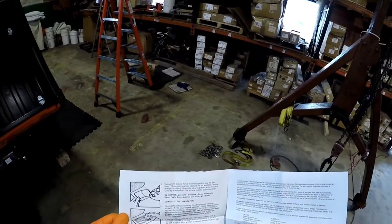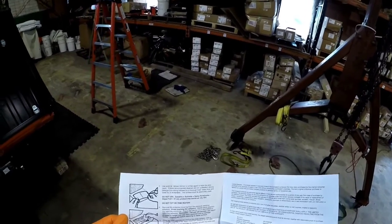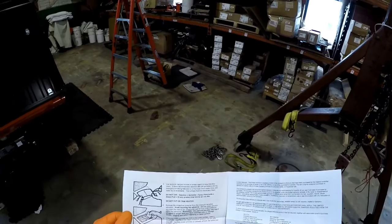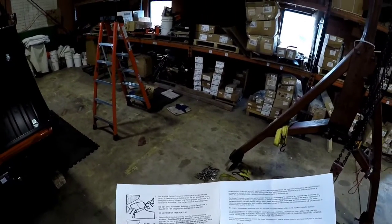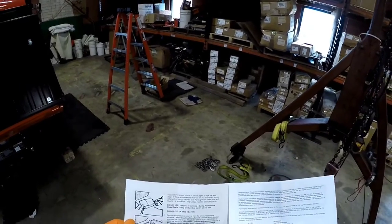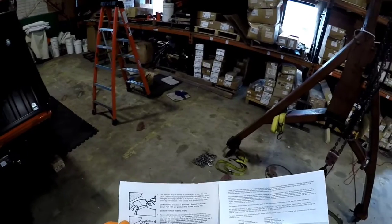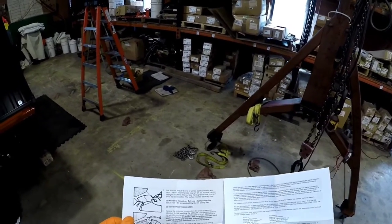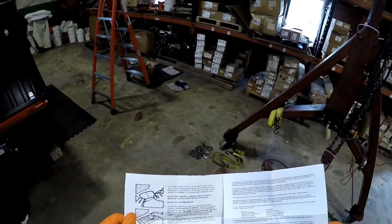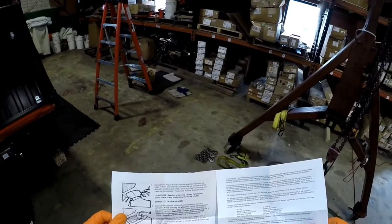Remove the protective covering from the pressure-sensitive adhesive. Avoid touching the adhesive. Decide which direction you want the cord to go. Plug in the pad for 3 to 5 seconds to warm the adhesive. Warning, the pad will become very hot if plugged in any longer and may burn exposed skin or damage heater. Unplug pad before applying to metal surface. Place the edge opposite the cord on the clean surface.